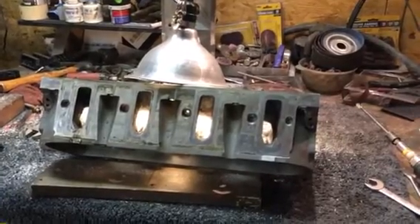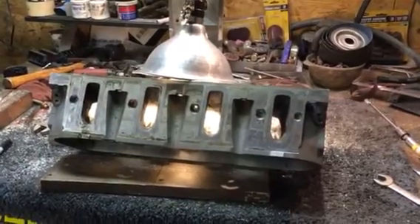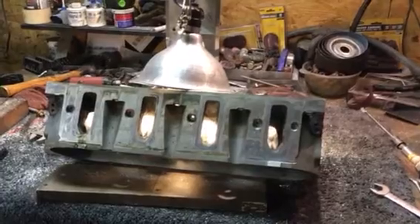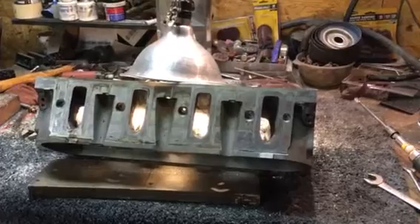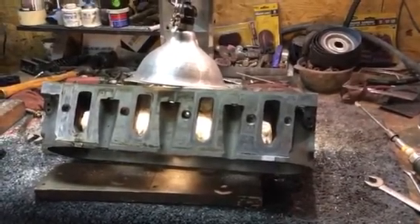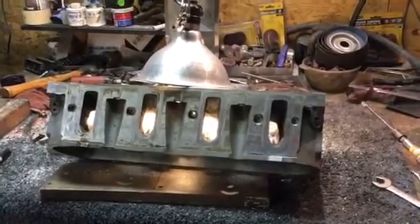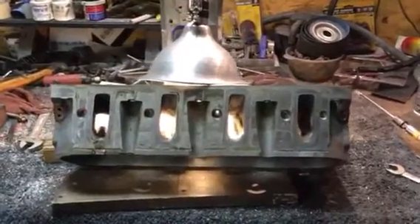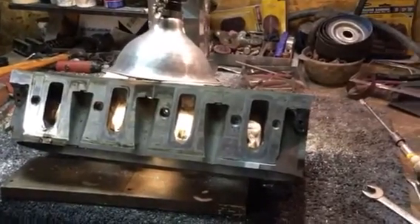So when you do streamlining of a port, keep in mind that air is going to go straight - it ain't gonna turn. Don't waste time working in areas the air is not going to go. Now if you're under a boosted application, where that boosted air fills that port, you may be able to have some successful flow gains associated with just volume - like if you want to build a port with a larger CC volume, that's somewhere you could just make it bigger.